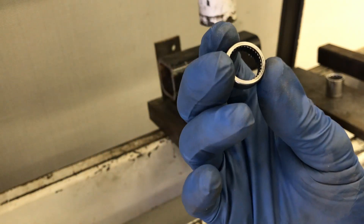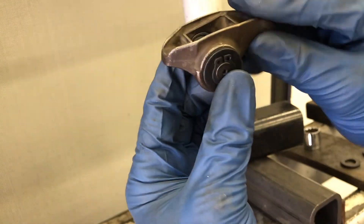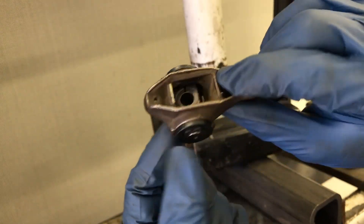It is a pretty good chunk of change, but in my mind well worth the investment because the races that hold the needle bearings are a much better design and it comes with a washer and a snap ring to help keep the trunnion from coming apart. So once that's together, it won't come apart inside your motor. These also have a better oiling system than the stock trunnions and overall it's just a weak spot on the LS and an upgrade you should do anyway. So we're going to need a shop press, so we'll head on over to the big shop and get to work.